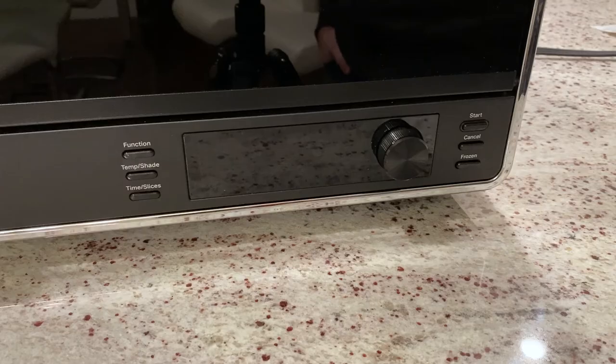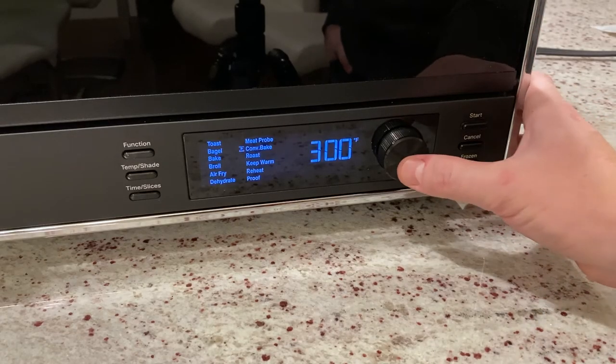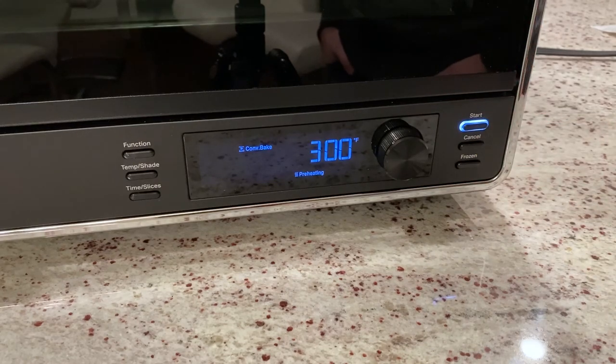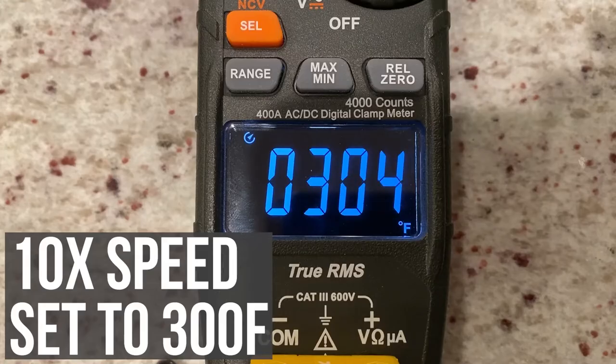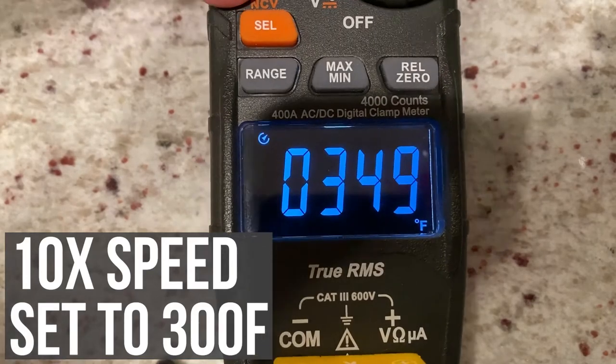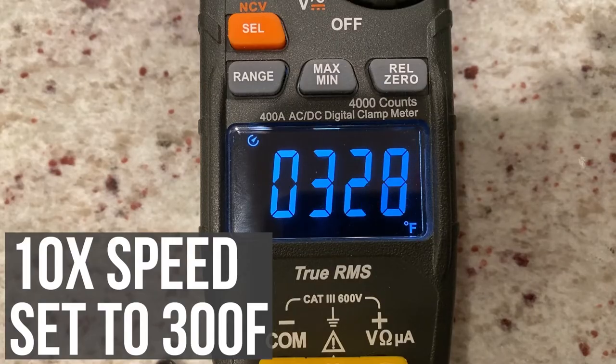The final thing I'm going to dive into with our temperature measuring instruments is accuracy — basically, if I set it to bake at 300 degrees, how consistently can it hold that temperature? Unfortunately, after looking at the thermocouple results after 10 minutes, I've got a disappointing story to tell. The oven hit 390 degrees and then cooled to 292 before reheating to 350 and falling again. This means we were anywhere from 90 degrees over to 8 degrees under. So despite doing very well on preheat time and cooking evenness, the KitchenAid fails when it comes to accuracy.